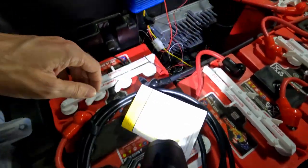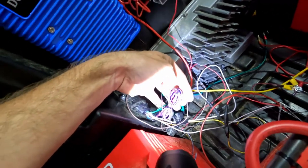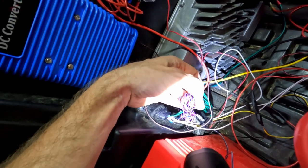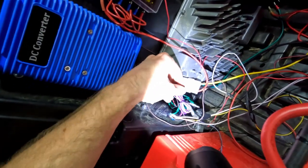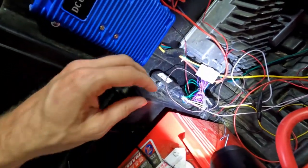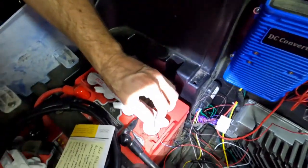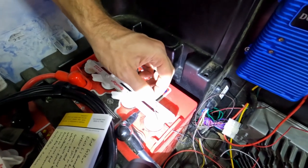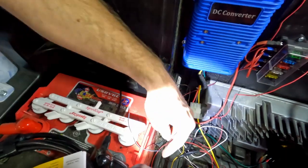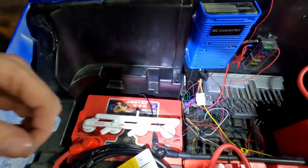The purple wire, the red wire with the white stripe, and the blue wire I've got balled up and stuck off to the side — I didn't connect those and it doesn't seem to matter one way or the other. The final wire is the black wire with the white stripe — that's your antenna wire. You want to make sure that's kind of up and out of the way. Mine works just fine; I stuck it in the loop of the battery.